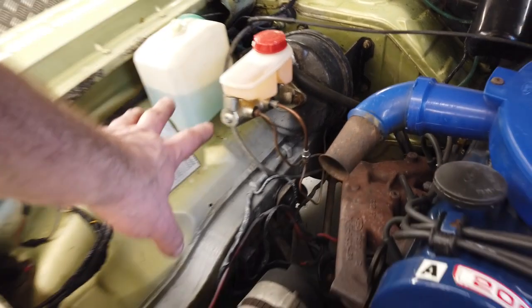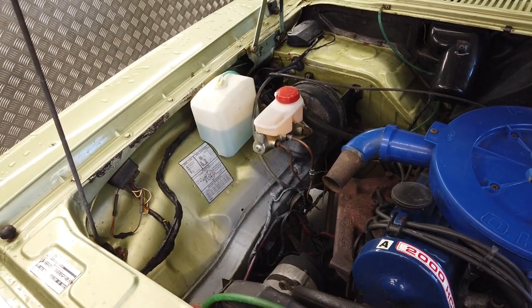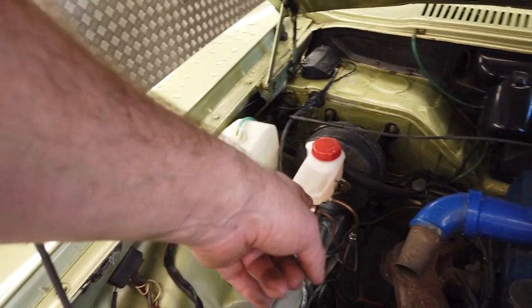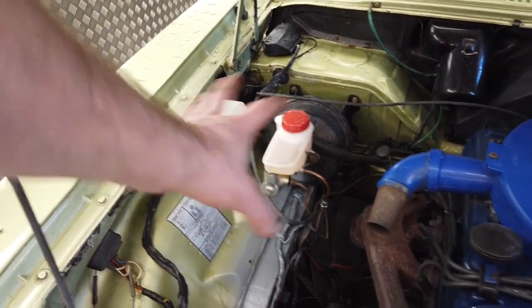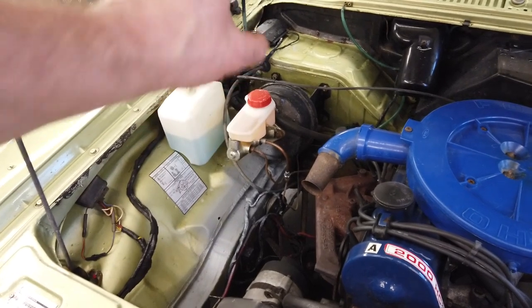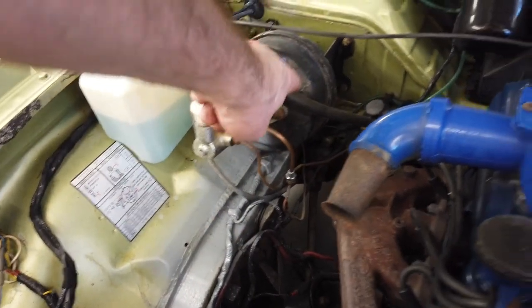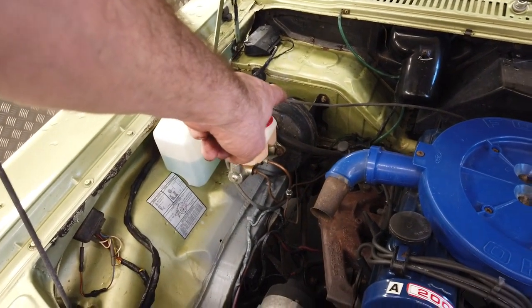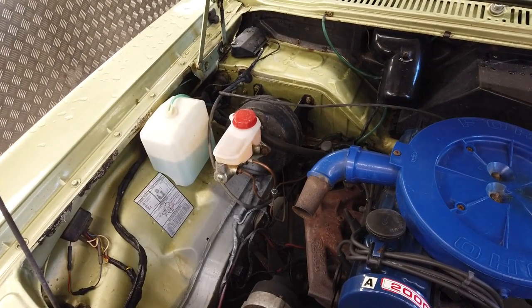This was done quite quick because it went on the Grand Tour. This blue had blown before the car was getting used on Grand Tour. We had to quickly do that, which is why the pipes are just bent. I had like a night to do it, to get it on a schedule that we were doing. So that's terrible. Those pipes need to be all properly shaped back in and all tidied up. Take off the servo, strip it down, shot blast it, and repaint that two-pack, paint back that master cylinder vac servo.